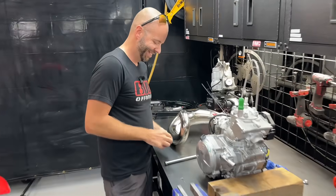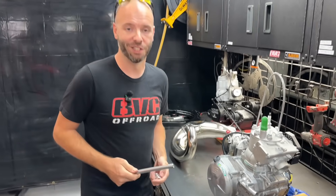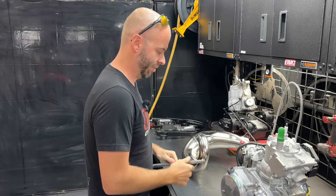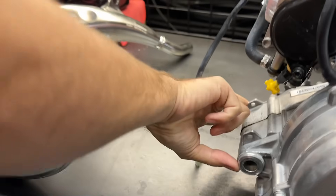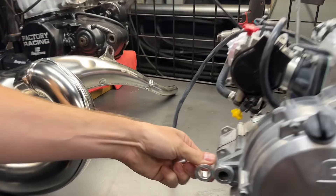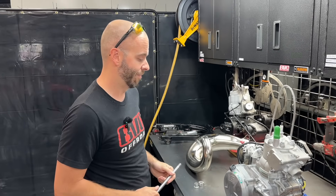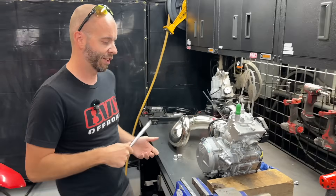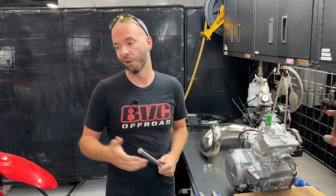You're not going to put a dirt bike engine into an ATV frame with the stock engine bushings. Here's our TRX 250R stainless pivot bolt and you can see how much play there actually is, so we machined some engine collars on our CNC lathe. You can see the size difference right there. We've got it sized for the TRX, making all new motor mounts, all the frame mods. Let's get the engine installed — we're going to put it on time-lapse and get the engine in.